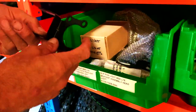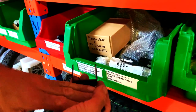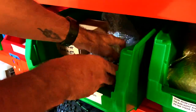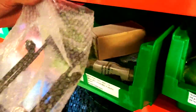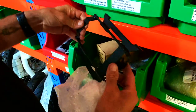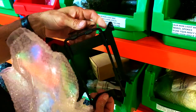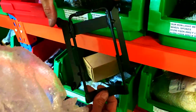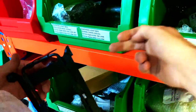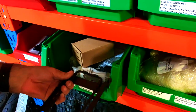So headlights. So this is the X version headlight bracket. So that mounts on the top of the handlebars. There's your little X-Version headlight mounts there. This is the L1E headlight mounting bracket. So this mounts... Oh, yeah, it holds a much bigger light. Yeah. This mounts on the top of the front of the D&M fork. Your speedo mounts on that, and then the L1E side brackets and headlamp bolt in the middle here. And so the indicators on the side or not? Indicators are mounted on that trim panel as well, yeah.